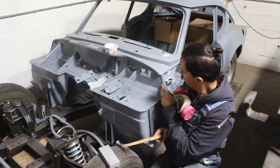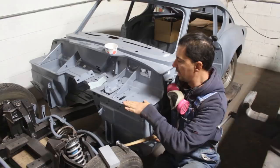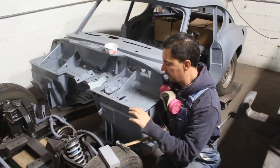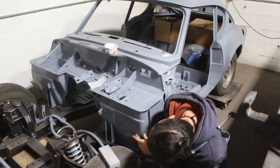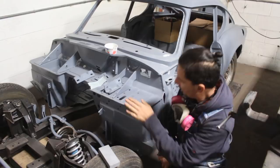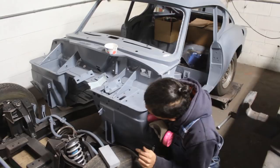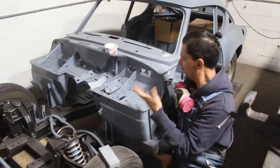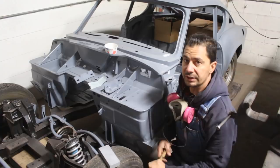So I want to deal with this — I don't know if you can see them from there — but there are a lot of spot welds here on the deck and I want this area here to look nice and smooth, because I know from my Spitfire that this area is really exposed. When you open the hood, it's right into your eyes. And also here I can see that something happened here. I want to smoothen this area and then we're going to look at the other side as well to make sure everything is nice and clean. Here I can see the bare metal is showing, so we're going to smooth that out with body filler.